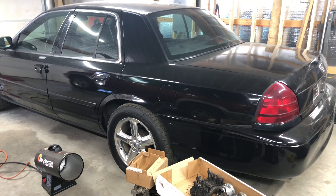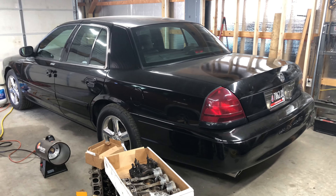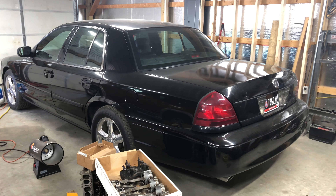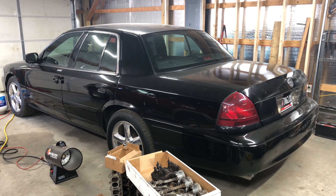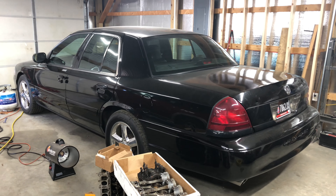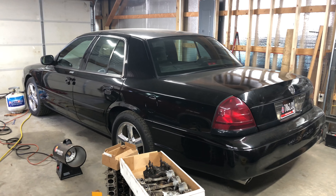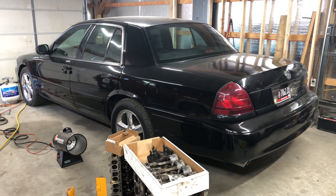I've got the Marauder moved over in the last bay just to get it out of the way when we brought the Explorer in. I've had to do a couple more adjustments to that transmission range sensor. Sometimes when it's cold - like today, it's about 30 degrees outside - I have to run it through all the gears for it to register that it's not in a drive gear like reverse or drive. If I hop in the car right now it may or may not start, but if I move the shifter from park down to first and then back up into park, it fires right up no problem. So I know it's that range sensor - it just probably needs a little bit more adjustment.